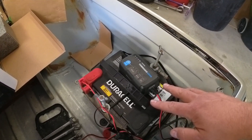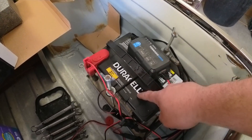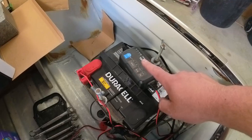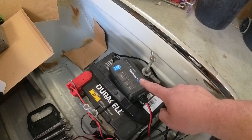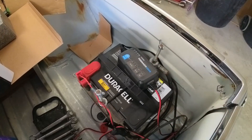When you're troubleshooting electrical components, the first thing you need to do is make sure your battery is up to charge. Because this car had been sitting, I did replace the battery and I did crank on it a little bit to find that I had a crank no start. So I made sure that I put it on my little charger to make sure the battery was up to speed.